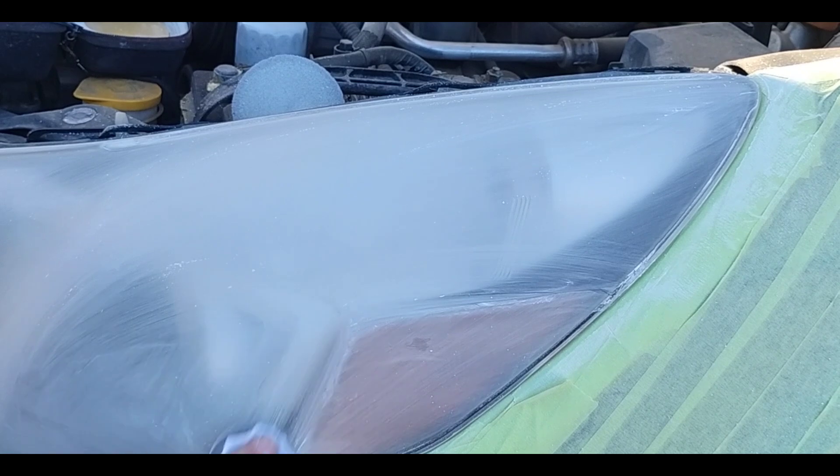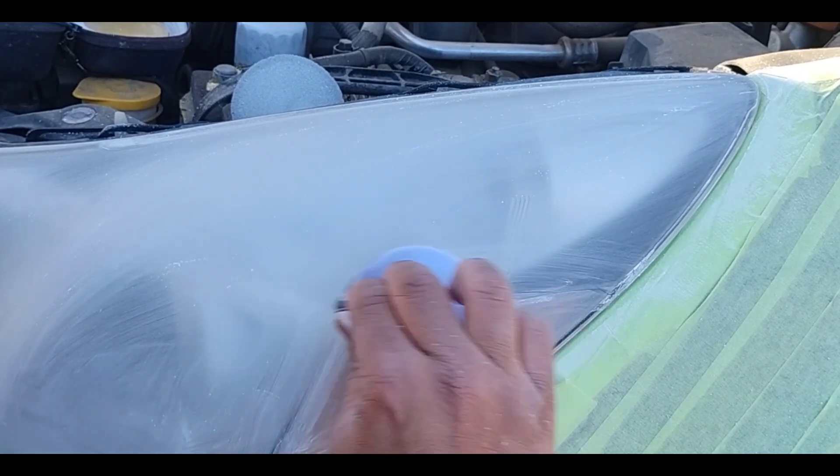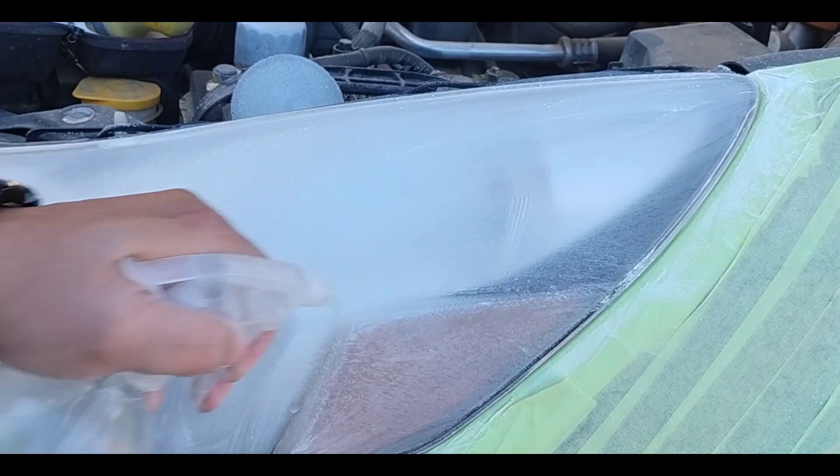You see how I dry sand first, and then I wet sand. This method — knowing when to wet sand — will definitely help you. So the principle behind this is that whenever you dry sand, whether by hand or machine, you're getting the full extent of the pad. I'm even going up there too, because there's a lip that gets really difficult to get with the rotary motion but easy to get by hand with back and forth or lateral movement.